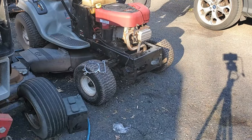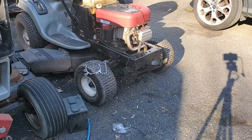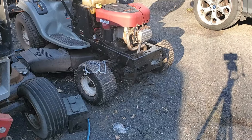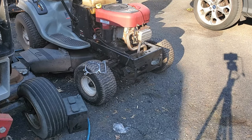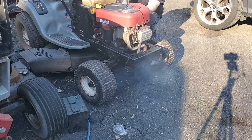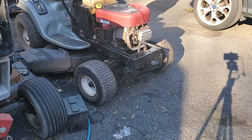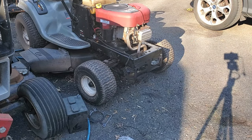I'm going to move the camera back so you can see all the smoke - it's going to smoke because there was oil all over the front of the tractor, and it always smokes after you do a head gasket. Let's see if it'll crank up. The choke is working. Set the brake - the deck's not releasing the way it should; luckily the belt's not tight. In neutral with the brake on, we'll crank it a little bit then put the choke on. It started right up but was running rough because the choke did not release - the linkage is a little bent from the replacement carburetor.